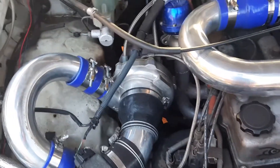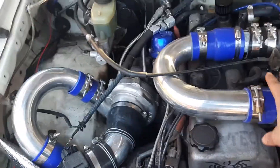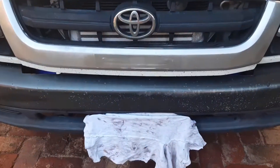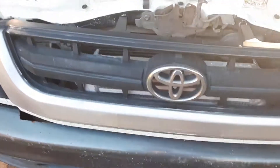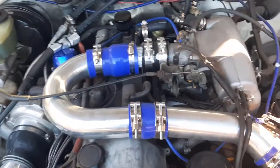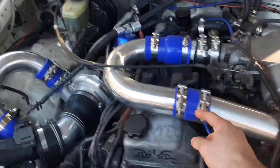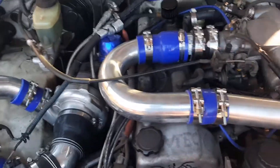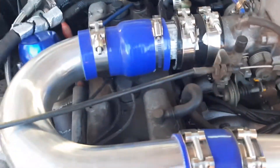The turbo itself is $200 from eBay, and I got it running through a $130 intercooler piping kit that came with all the clamps and silicon joiners, into - if you can see it there, it's pretty sneaky - into a front-mount intercooler, I think about 300 millimeters across. The annoying part about the 3RZ is that its throttle body sits over the valve cover, so all the cold air from the intercooler just gets heated up again by the valve cover right under it.